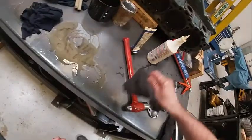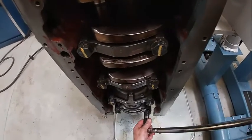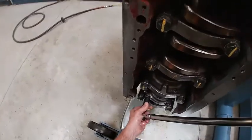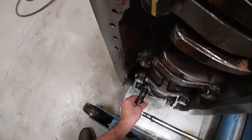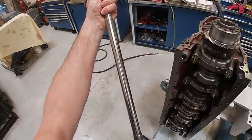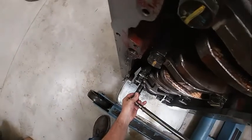Don't try and put the piston in at top dead center because you'll never get it in. Same thing here — we're going to snug it, do the tang side first, torque the other side. I forgot to put oil on that, so I'm going to take it up to 137, which is what the spec was.